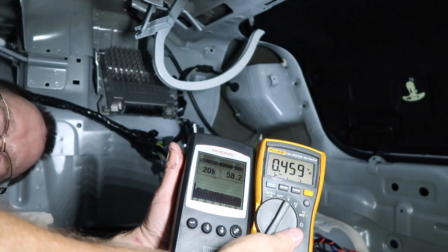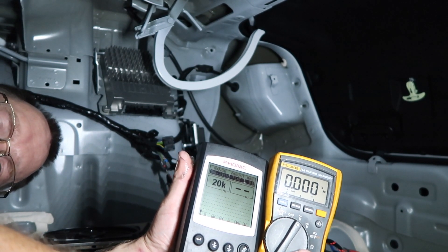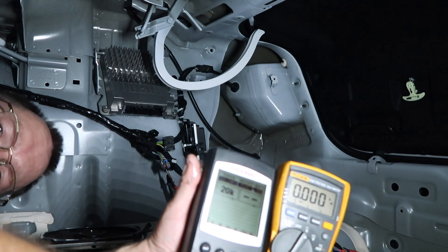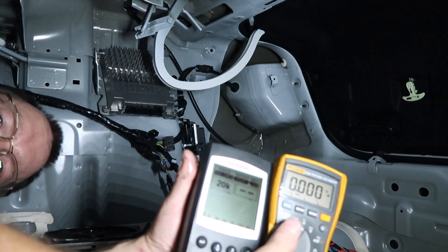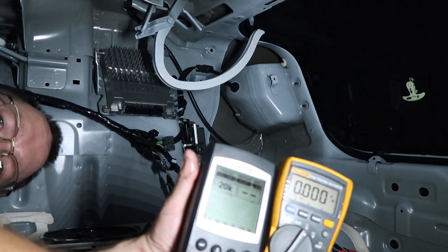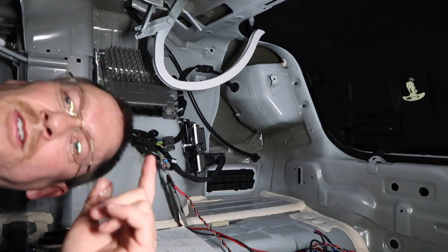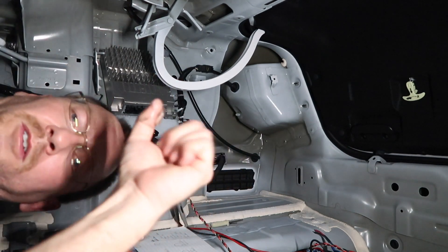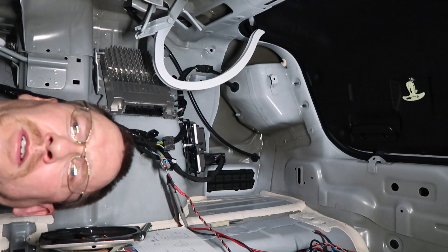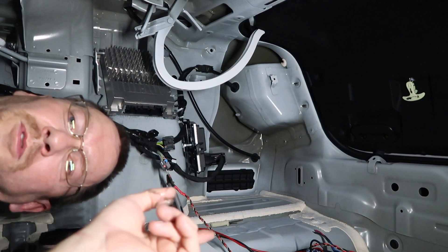We're looking at the signal all the way up on the two front doors. We rev the engine and look for any fluctuation in voltage or ripple in the RTA — noise cancellation would typically show a ripple in the low end and a voltage change. We don't see any of that. Also, noise cancellation systems in GMs usually have microphones on the ceiling by the grab bars or in the center of the headliner — we didn't see any in this car. And GM doesn't typically do fake engine noise in most of their cars.